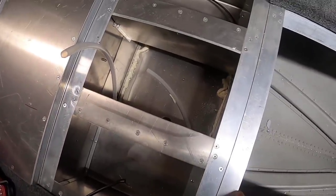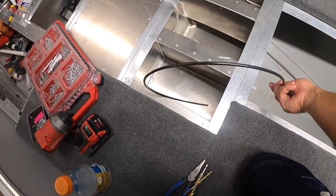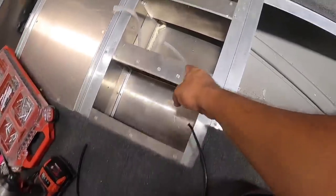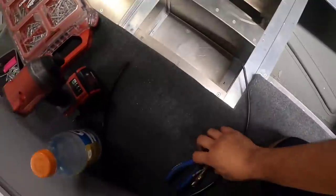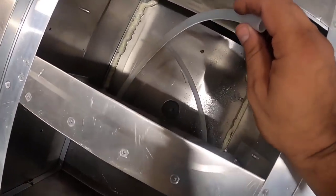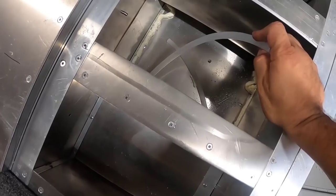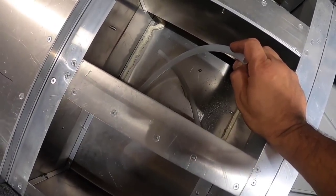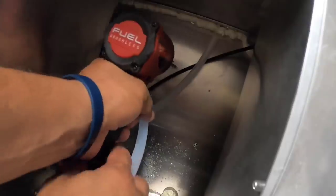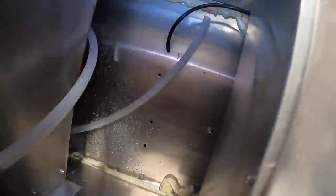We are at the point where we're going to install these makeshift DIY secondary compartment drains. We're going to run these into the subfloor. We'll be running those tubes down into the middle of the subfloor so all the tubes will be collecting right in the middle of the subfloor, and we will seal them off right before we pour foam. Those small black drain tubes are just garden hose that I flattened out with a rivet and a heat gun. The other stuff is that same kind of water line you run to a water station in your house — they'll all work just fine for simple drainage.